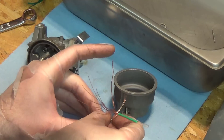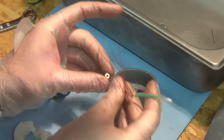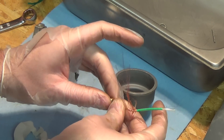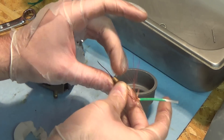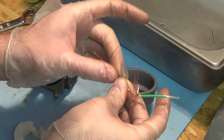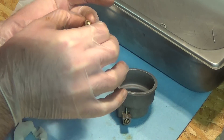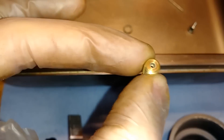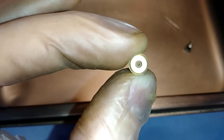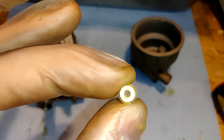Working it back and forth — the edges of the little strands rubbing against the side of this brass fitting will wear off any kind of corrosion on the surface and make it flow better. Yeah, it feels like it's actually probably quite a bit smoother now. So I reamed that plug out, and you can see quite easily that now it's actually pretty clear to see through. As I move around you can see different colors coming behind it. I think that could have likely been our problem here.